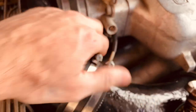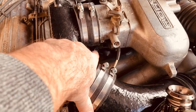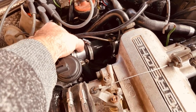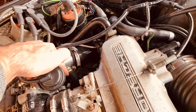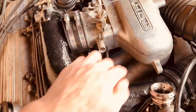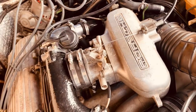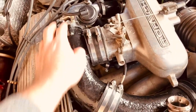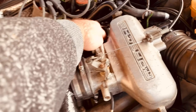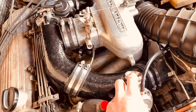It's sort of like that one — it comes from a VW and is connected between this T and the idle valve. This T was originally mounted here and connected to the idle valve, but now it's relocated. The bypass valve is no longer in its old position — it's here instead. The additional blow-off valve is also no longer in its old location; it's now mounted on this component.